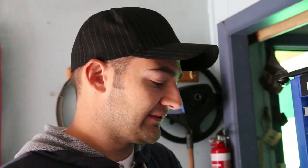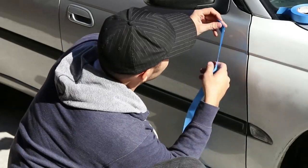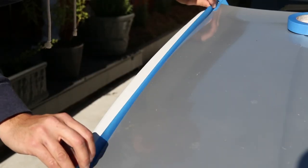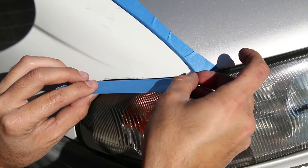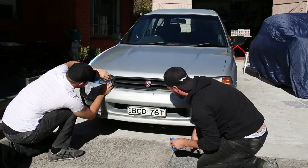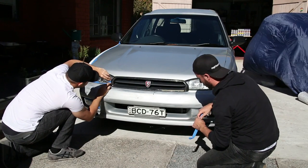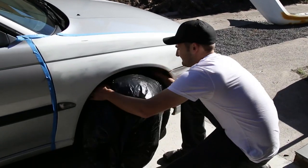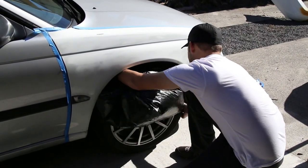Are we about to pull the whole car apart? That's one way of doing it. You've got to make the decision whether you want to pull more panels off and do less masking, or do more masking and leave them on. You can take the panels off the car and then paint them, which means you don't need to worry about masking anything. But to show you guys, we've decided to leave the panels on the car. Just remember, you do run the risk of overspray. Taking off panels means zero masking, but there is more spanner spinning — so work out what's best for you.